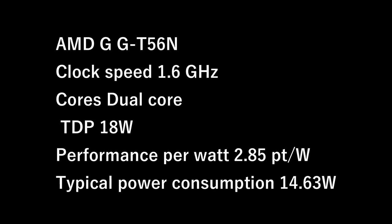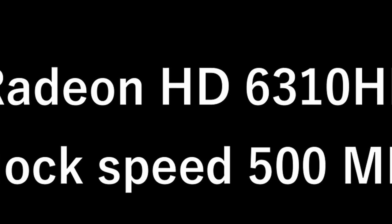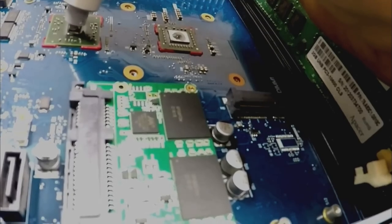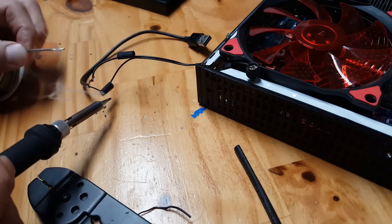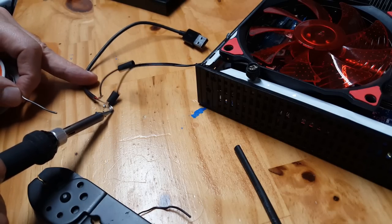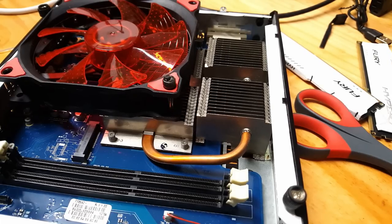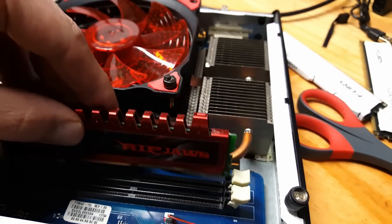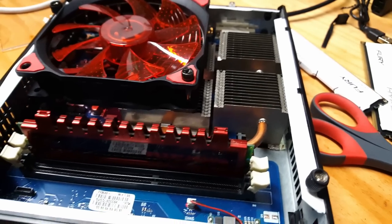As for the specs, well, they're rather low because thin clients are low wattage devices. Nevertheless, I'm tossing in a 120mm fan over the passive cooling system, just in case pushing the system for games causes throttling. And yes, I'm wiring a 12-volt fan to run on 5 volts. It'll push just enough air over to places where needed. Now 8GB of DDR3 might be a little bit overkill for the games I'm going to play on this, but you know, it matched the fan and I think it looks good.